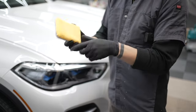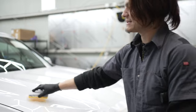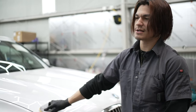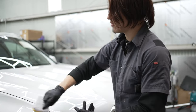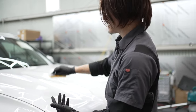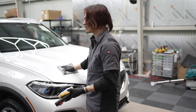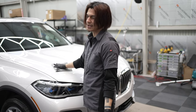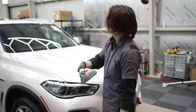Because if I prime it and there's all this coating right here, I need to either dab it out a little bit or I need to go back over it twice. Because the first area I touch down on is gonna have way too much, and an area like over here is not gonna have enough. So you wanna go back over it in a crosshatch pattern, up and down, left and right, in that area. Once we determine it's grabby enough to start removing, it's been 7 or 8 minutes, depends on the weather that day, then you can go ahead and start buffing it off, and you'll use the first towel to remove it.